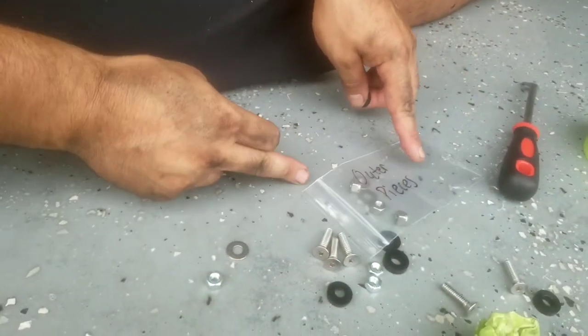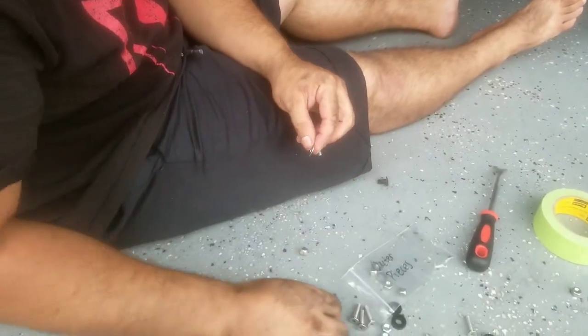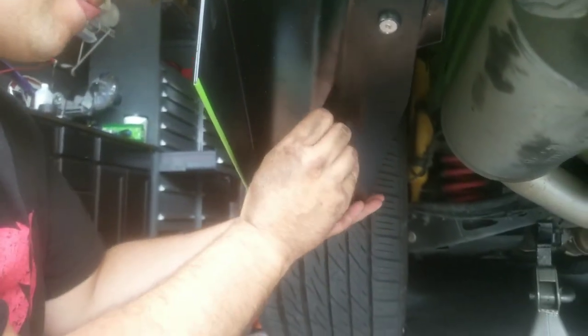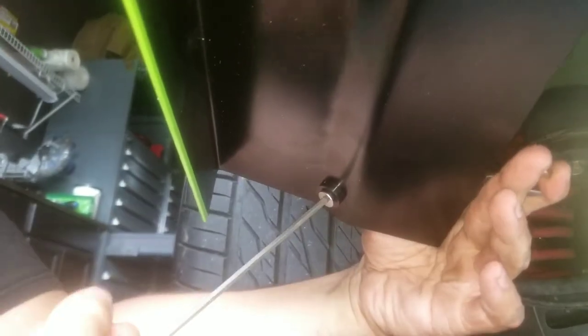You've got your bolts that come in the outer pieces bag. Put your countersunk on there — that's going to run through your side spat and the rear valence, and then the washer and nylon bolt goes on top and you tighten it down. That just slides in. Washer and then bolt — same thing on that last one. Nylon washer, bolt, snug them up. You don't want to go over tight on them — there's a piece of plastic there so you don't want to overtighten and risk breaking something.